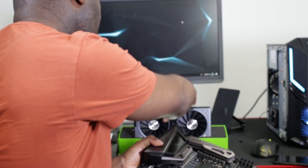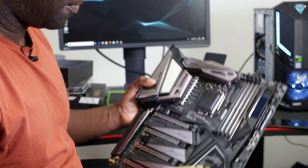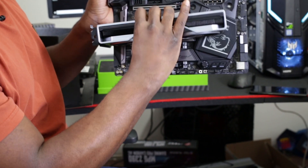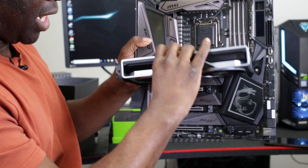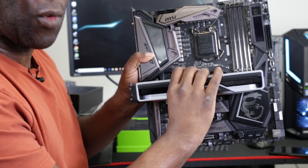So if you're looking for a graphics card or you've already got one for your custom computer, make sure you take it out of the x8 slot and put it in the x16 bus speed slot. I guarantee you will get higher performance. Just follow that one step and you'll get your proper speed and frame rates for your games.